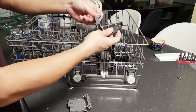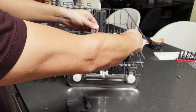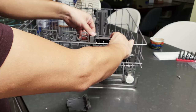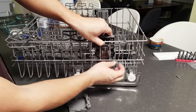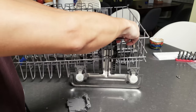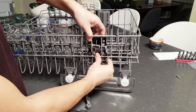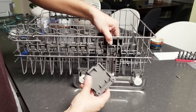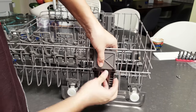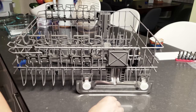Install the actuator on this side, making sure it's correctly aligned and facing towards the front of the dishwasher, then drop it into the big groove — it should fit really nicely. Again, make sure the wire sits in the groove by pushing it down slightly until you hear another click. Then get the cover on and push it in to lock it in place. Very last step: use the two screws to secure it firmly.